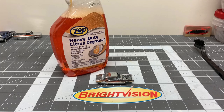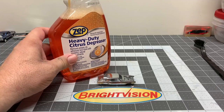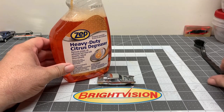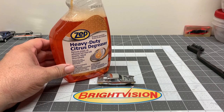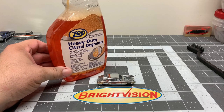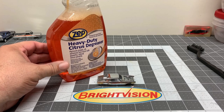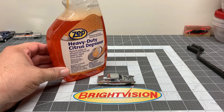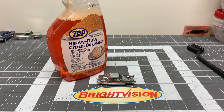After we finish polishing the car up, one of the next steps before painting is to use a degreaser — spray it on down using a plastic brush or a toothbrush, scrub it on down and get into all the nooks and crannies. If your paint is bubbling up, it's probably because you have oils from your fingers or wax from the polishing on there. This step will help eliminate that. It's a very, very important step — please don't skip it.